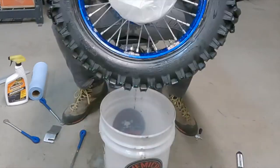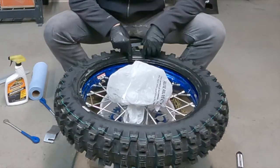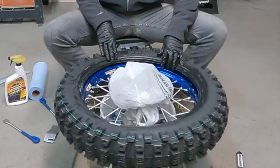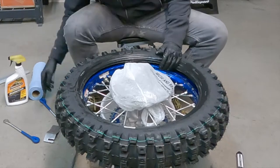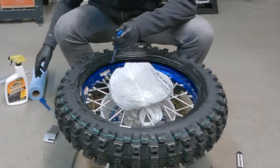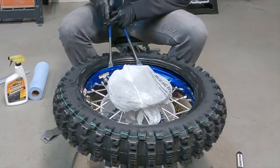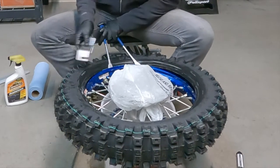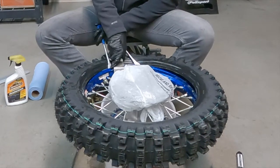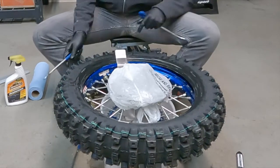Now we're gonna flip the tire. On this side, right now that we flip the tire, the rim lock is here in the middle. There's my valve stem. So my bead tool is gonna go on the left side of the rim lock. So I'm gonna put two spoons right in here, like so. Get myself a little bit of room. Slide my bead tool on there. Here we go. Cool. And that's my end point.